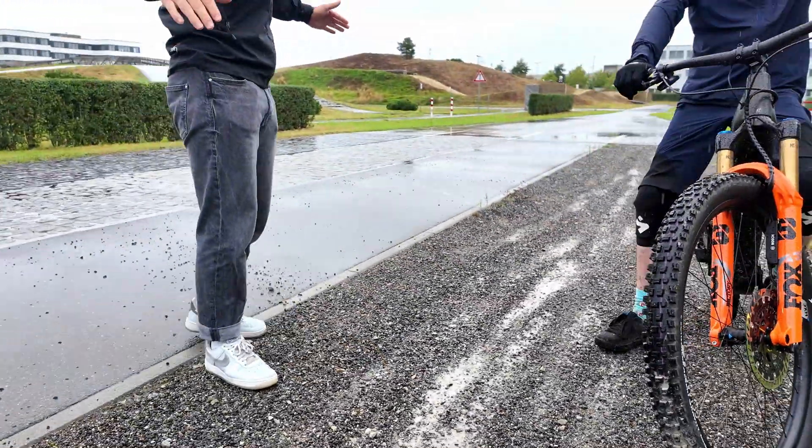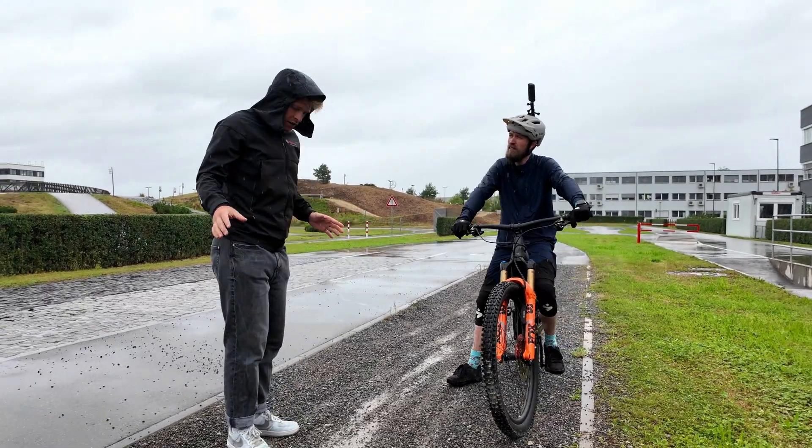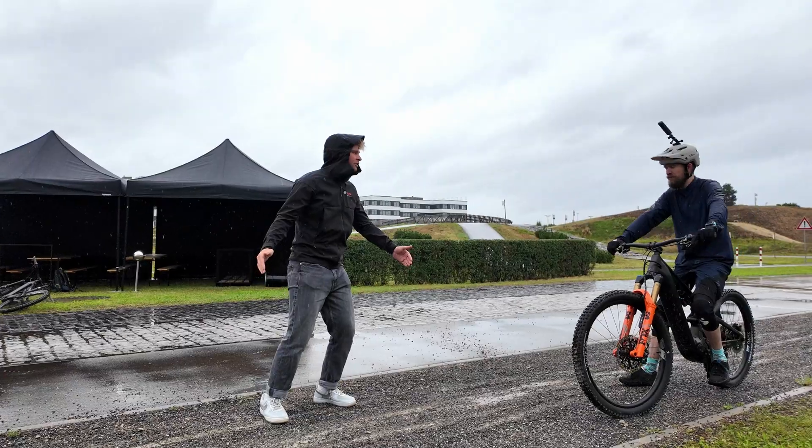When you go like this hitting gravel at 25 kph, you have a really short braking distance — but you're not sliding away or crashing. At the end of the braking session it gets progressively deeper: you see the small blocking, the blocking gets more and deeper. Then you start sliding out. But the normal riding braking session stays between those extremes — you just brake through a corner.